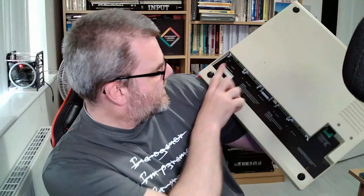What it allows you to do is run that as the different CoPros you could have. So you could have a Z80, another 6502 one, you can run it as an emulated 386, you can run it as an ARM. So you end up with a two meg computer here that then has a CoPro that runs like 190 something meg. It's just ridiculous. When you run Elite off it, it's just absolutely bonkers.